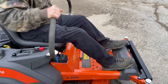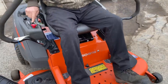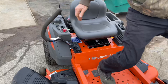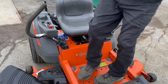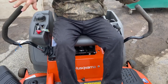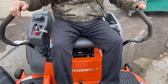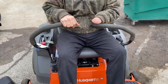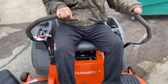Back to neutral — once you're back to neutral with your PTO off, your mower deck is off, and handles are all the way out, you should be able to get off your machine. As long as your PTO lever is off and your brakes are on, you should be able to get off while the engine is running if you need to do something. Remember: bring both handles back in equally and it will stay running; bring in just one and it's going to shut down.